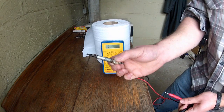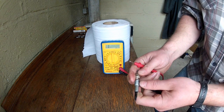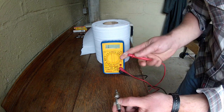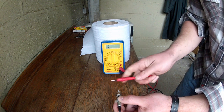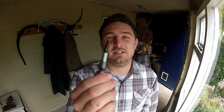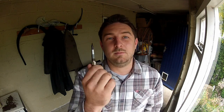The final glow plug — I've saved the sootiest for last, and I'm kind of hoping this one is busted. If your multimeter displays a reading outside the range of your current setting, that means it's not one ohm — it's faulty. So I've managed to isolate the faulty glow plug. A visual check would have been good enough in this case because it's the sootiest of the four, and there's a massive chunk of the ceramic tip broken off — that's gone through the engine at some point. One bad one, three good ones, but I'm replacing the full set as standard practice.